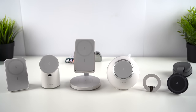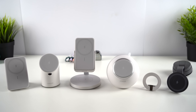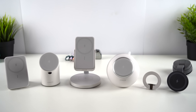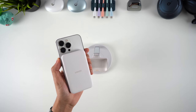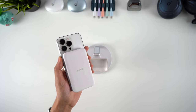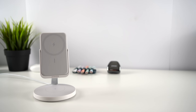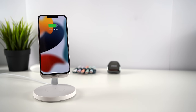So there we have it — that's our look at all six of the new MagGo devices. They're obviously not without their faults, but my overall impression is that this is a fantastic lineup of products. I feel like Anker's MagGo series are the MagSafe accessories iPhone 12 and 13 users have been waiting for. One drawback is that, as with most third-party accessories, Apple doesn't endorse them, which means they don't have the fast MagSafe charging speed at 15W — they're capped at 7.5W.